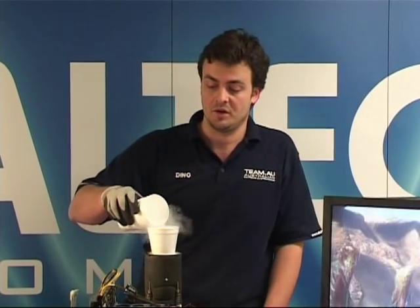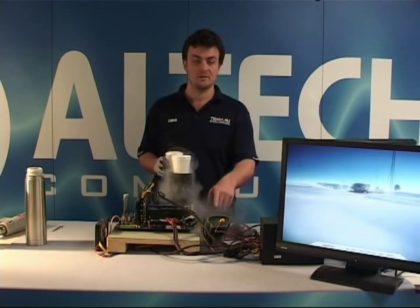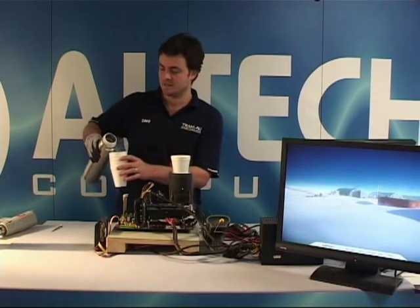And even though you've protected most of them, we've used Vaseline in this instance, you can never be 100% sure that you've covered everything. So it's better to just be safe than sorry. Most of these components are quite expensive. We are down to the last test in 3DMark06 called Deep Freeze. And my temperature currently is at minus 71, and I'm just bringing it down to minus 76 again, so that I'm in the safe zone, if you want to call it that. And we're waiting for this last test to finish.